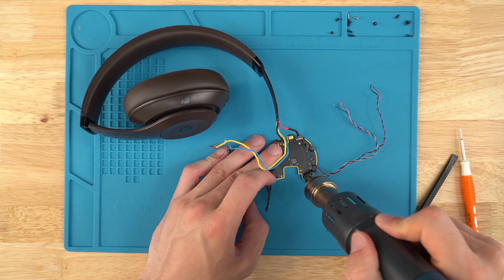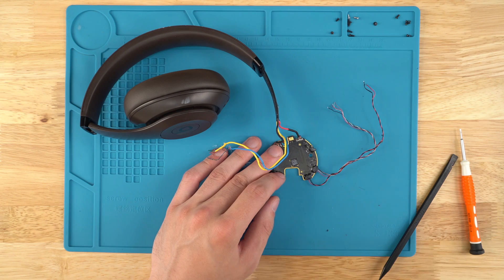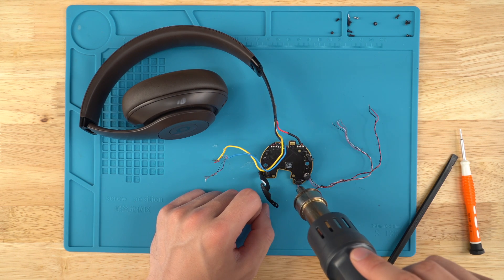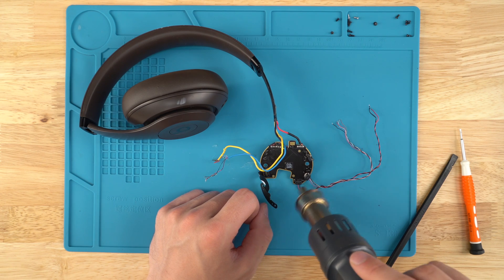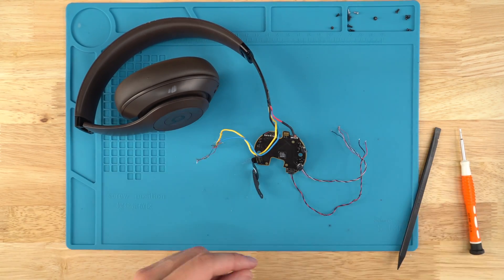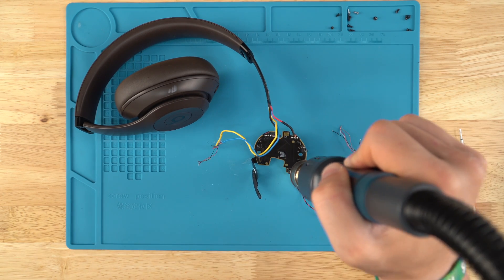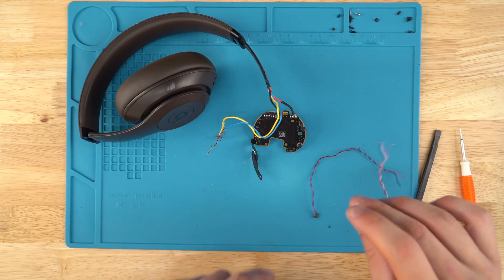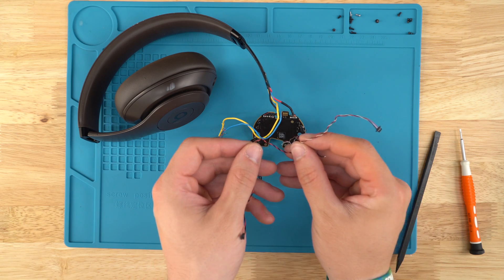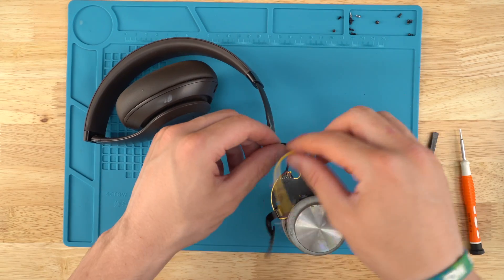We will remove these ports. I'll show you how to heat these up. I have my heat gun set to 200 degrees Celsius at 50 air flow. That's not super critical — just don't make it too hot, you don't want to melt any plastic. Keep the heat gun moving — don't hold it in one spot. It helps avoid melting plastic and having too much heat concentrated in one area. Once those are heated up, kind of pull — yeah, those are good. You can also get the flathead involved prying up some glue. Careful — the PCB will warm up. Put the MS port wire and the charger port wire to the side. This charger port is actually damaged — you can see the rip, those two black wires. The reason we're tearing this down is this main internal wire right here is ripped open.